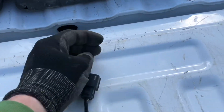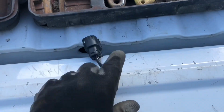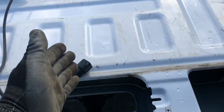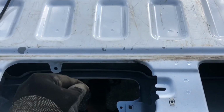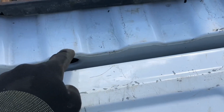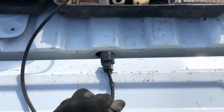And that's basically a piece of wire or any long strand of rope or something like that. It'll be taped to the end of this connector, and as you pull that connector through here, the piece of rope or whatever you chose to tape onto here will come through as well. When you get this connector out here, you untape that and leave the rope dangling out of this end, and the rope would still be all the way through here, all the way under your bed. Then when you go to reinstall this thing, you just tape this connector to that and pull on the rope over here, and the connector slowly feeds its way back through there.